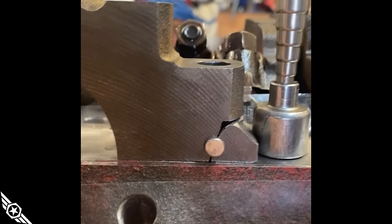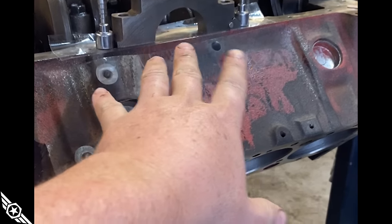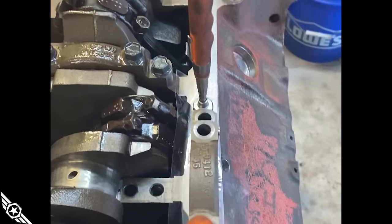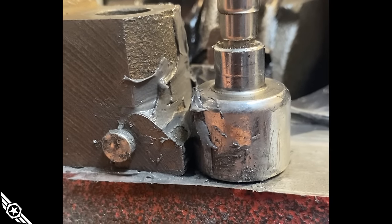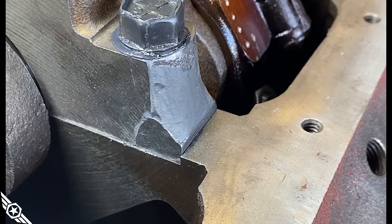Just calm down — it's not that bad. I hit it with a file to make everything fit-ish. The oil pan rail was the flattest surface I could find, so I put a little tape on there to protect it. I JB Welded it, sandwiched it between magnets, and used another magnet to hold it perfectly in line. Tomorrow night I'll file-fit the end of that main cap to the block to make sure there's just a slight interference when I bolt it down. There it is — just as much of a hack job as you'd expect. I made a custom main cap with JB Weld.